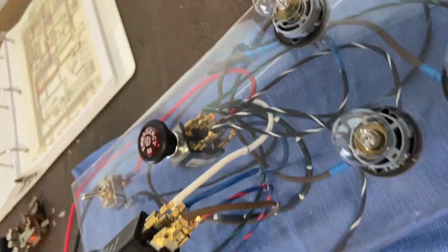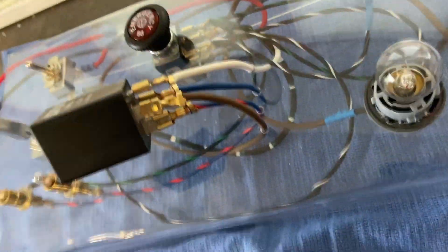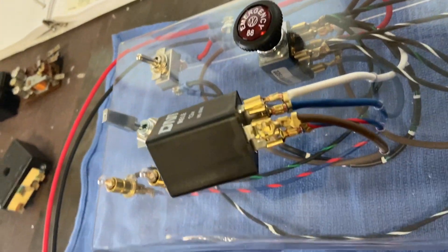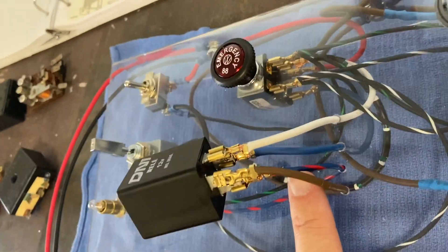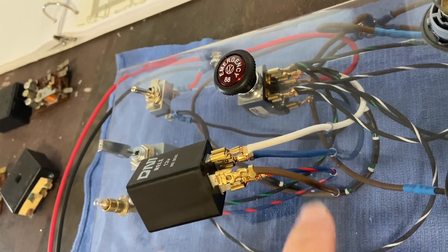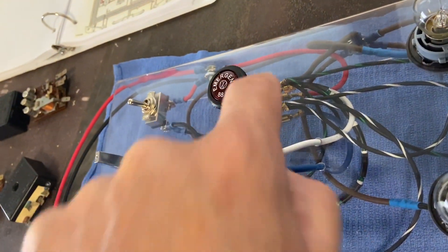So we've got the power hooked up. This is my turn signal jig. These four wires go on as per the wiring diagram, so there's nothing different there. Brown is ground. The red and blue is KVL — that's the ground for the turn signal indicator lights; it makes them go on. And then 49 and 49A, the power.